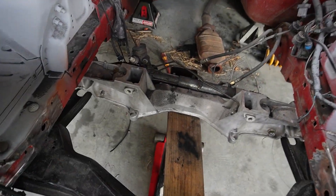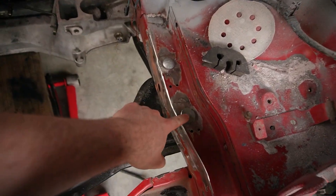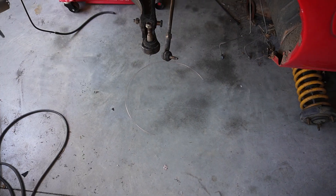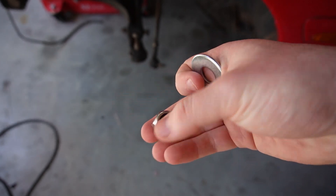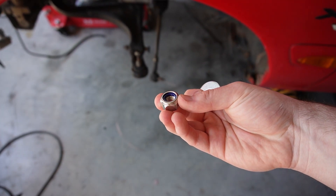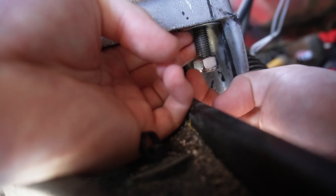It's quite hot in Melbourne today, very humid. Nonetheless, that won't stop us here in the Paken garage. It's in again for the 15th and final time — I hope — because this time I have dropped in some studs. We're using a variety of studs; we'll see which one snaps first. Once I dropped all the studs through, I got myself some washers and some Nylock nuts. Nylock nuts are actually used on the factory subframe as well, so I figured why not employ the same logic. Threaded them on loosely by hand and then tacked the studs on top of the frame rail so we can actually tighten it down properly.